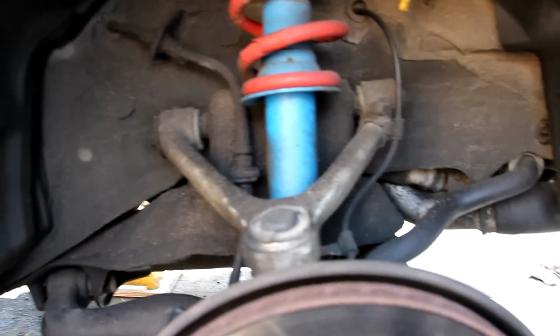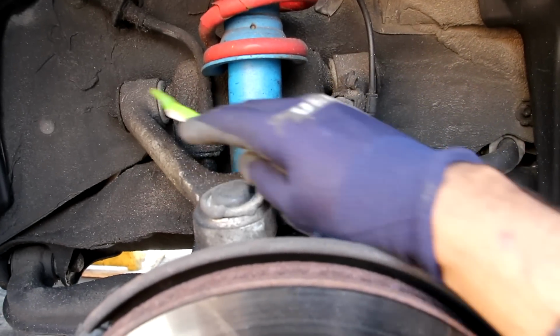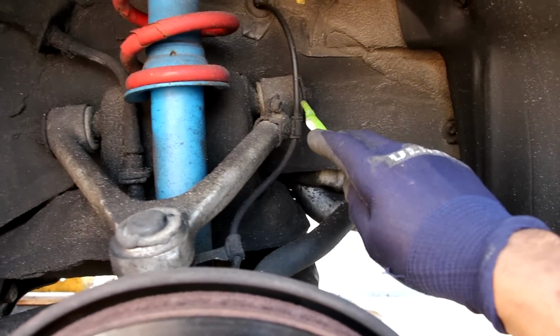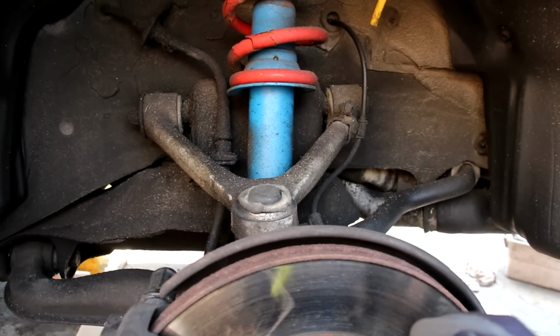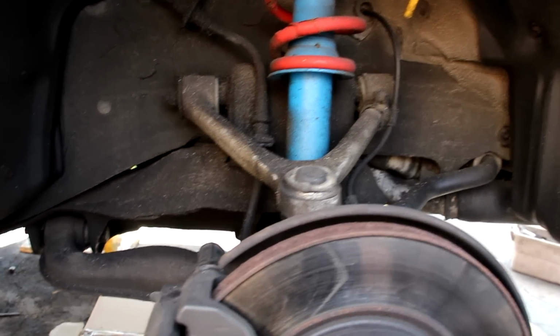Now overall, servicing the suspension should not be too difficult. It's pretty easy to work on, with the exception of one really long pivot bolt that goes through the upper control arm and has to come through the splash guard over here. Although it is a double wishbone design, it's going to be a little bit more maintenance than a McPherson. For a sports car, it's well suited.